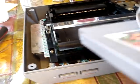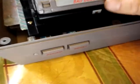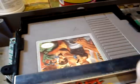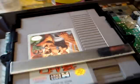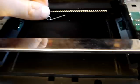Let's put this game in and slide it in there. Now I'm just going to take this and test it to make sure it works okay. As you can see, I'm still having some problems, so I'm going to have to go in and try to bend those pins up some more. You don't have to remove this black thing to do this — I just did that to demonstrate how to remove it in case you want to take the whole motherboard off.